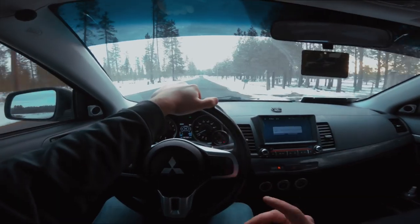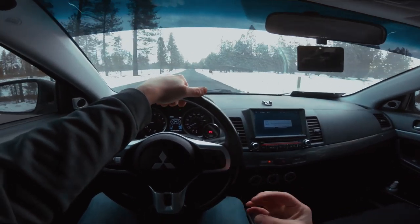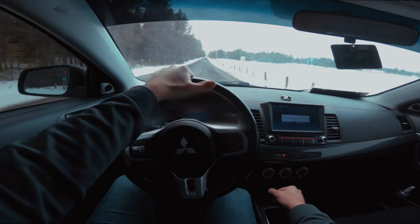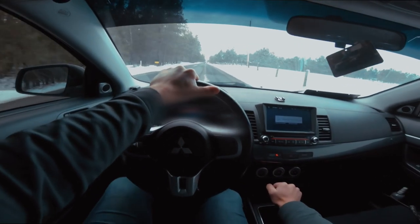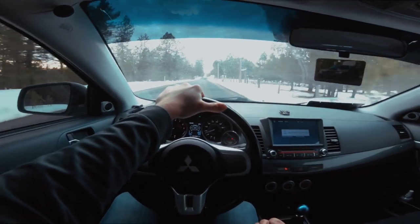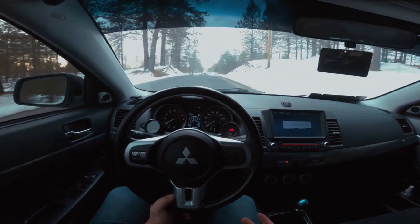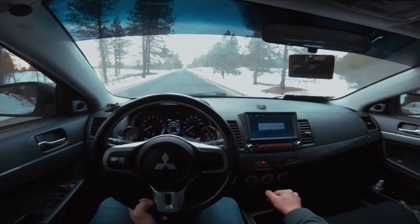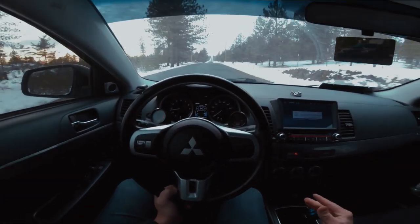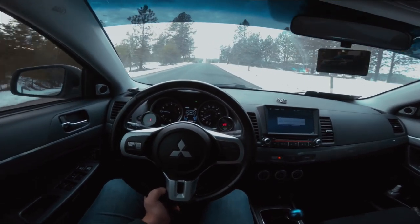Like I said, it feels a lot more connected. There is one more thing I'm going to do regardless for preventative maintenance that could help this issue - it's the Magnus master cylinder upgrade. I'll explain it more in that video, but it should help with shifting as well. I still feel that lockout regardless. It honestly feels like my clutch isn't disengaging all the way - that's literally the best way to explain it. My shifter does feel way better. Ditching all those rubber and plastic bushings and going with aluminum bushings, it feels pretty clean.